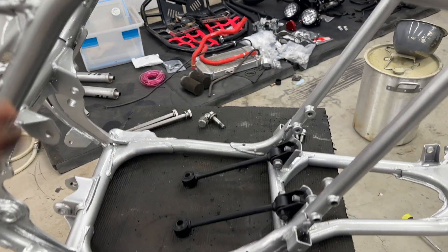I like to throw a towel in so I don't beat it up too much. I'm attempting to get these in there without having to take the spark plugs and things out or disassembling at all. We have our new bolts - we're going to take the long one and get it through from this side, because it won't go through straight the other way. I did go ahead and coat it with some anti-seize. Everything I put on these things I try to anti-seize because it's just a pain when you're trying to take it apart and you don't have it on there - hence why I had to cut the bolts off the front.